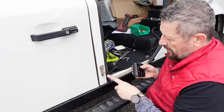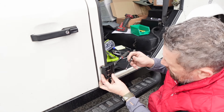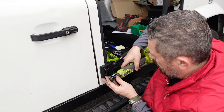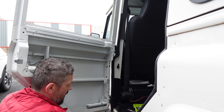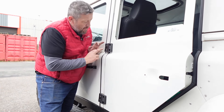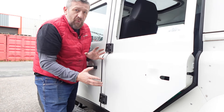Same scenario at the bottom — fitting the bottom one first, just very loosely. You're basically just switching one for the other, just making sure you've always got a bolt in that captive plate. The door at the moment is fairly light because there's no furniture on it, so I can just feed these bolts through with a washer and a nut on each. The first job I want to do before I start fiddling about is get the check strap back on to protect my B pillar. We don't have any adjustment on these bolts on the doors, so you can go ahead and tighten them up.